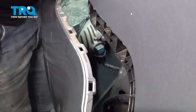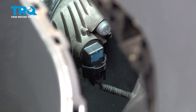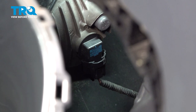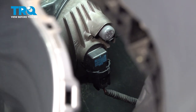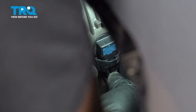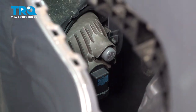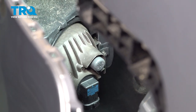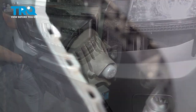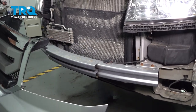It's going to unlock from underneath your headlight assembly. As you pull this out, look down behind — if your vehicle is equipped with fog lights, you're going to have a connector down there you want to disconnect. Simply reach down, press on the tab, and pull that connector off. As you continue to pull the bumper off around the front with the grille, you're going to have the passenger side fog light to disconnect as well. Now that we have the fog lights disconnected, you can remove the bumper and the grille in one fell swoop.